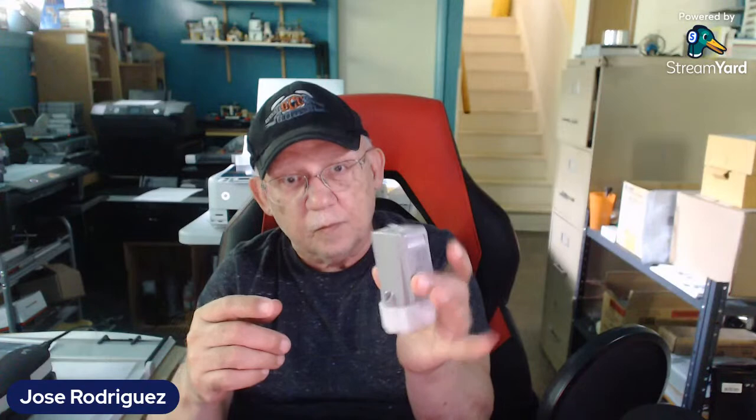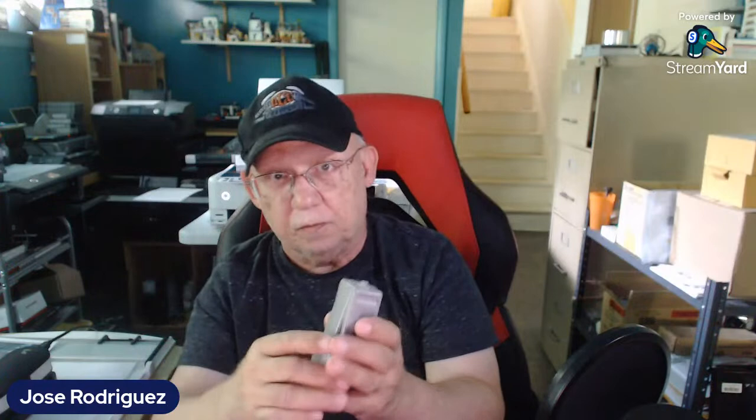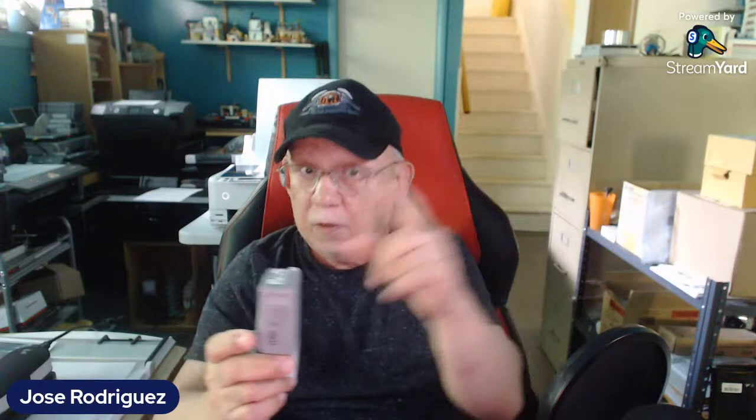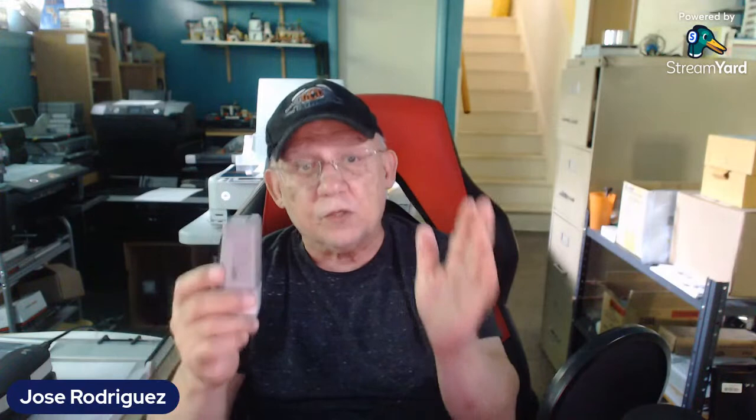Now you have a mismatch. You have a full cartridge, but this chip says you're not full. The chip may say you're halfway down. That's okay. Continue printing. If any other cartridges are in that same condition, say like halfway down, drill them, top them off. Precisioncolors Signature Edition inks are so good, you can just add them to the existing OEM ink.